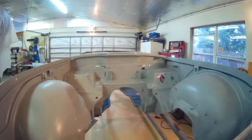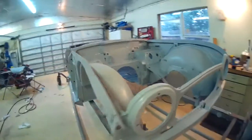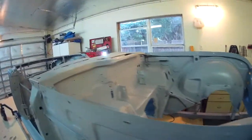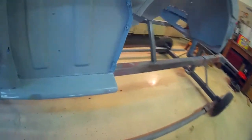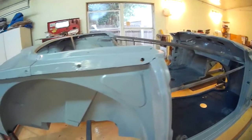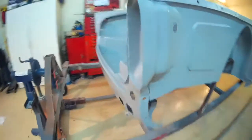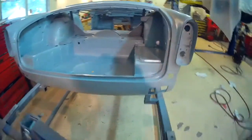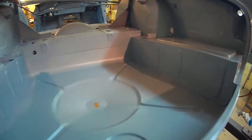So I cleaned everything up, sanded the edges, and put on a coat of the epoxy primer sealer. The areas are covered and it actually looks pretty good. I'll scuff them a little bit before I put the seam sealer in, because it will be more than 36 hours before I get to that part. I've only done about half the car — with the firewall inside and out, the rear quarter panel areas, rear trunk and floor.